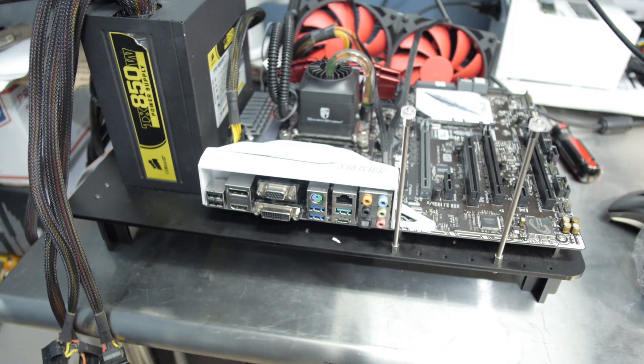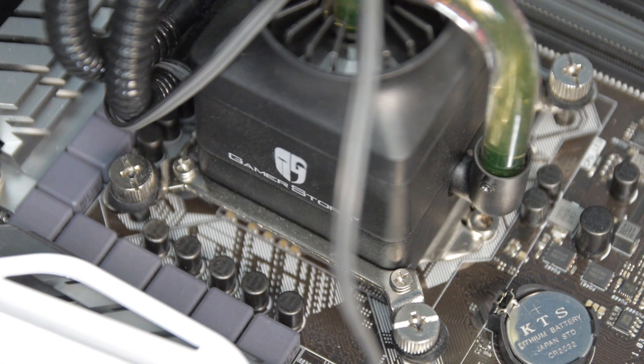This is sort of the same color scheme as other ASUS channel motherboards, but the power delivery system is a little simplified versus the Deluxe. With the Deluxe, you have the combined heat pipe and fancier heat sink assembly; here we just have two separate heat sinks that rely on airflow from the case or CPU cooler. There's plenty of room around the CPU socket — the capacitors are low profile, so there shouldn't be any problems with tower coolers. We tested a bunch of Noctua and other tower coolers without any issues, and all-in-one water coolers are also fine.